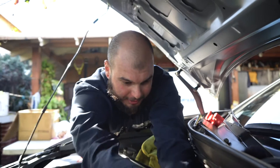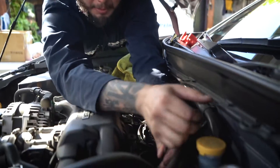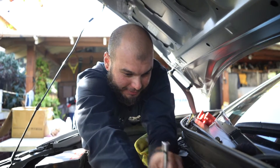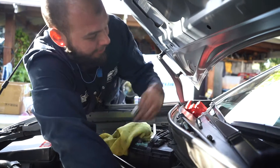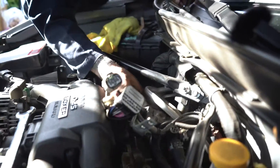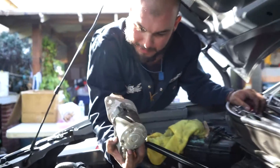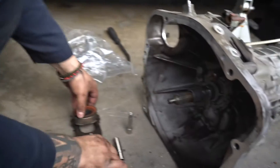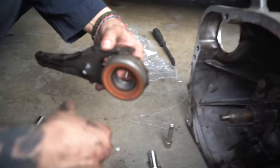It's a single disc. We'll get to it right now. So we took off the starter — pretty small. We're replacing the throw bearing because it's making a whining noise, as you can tell.